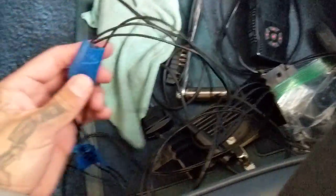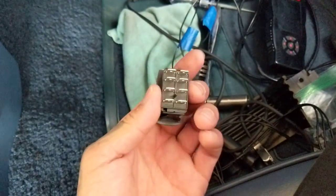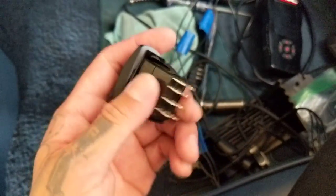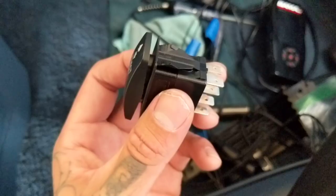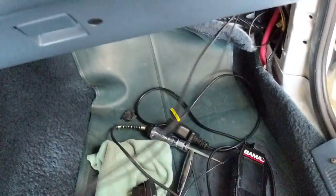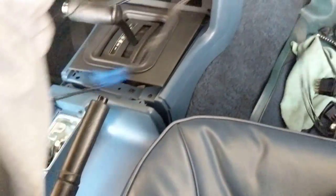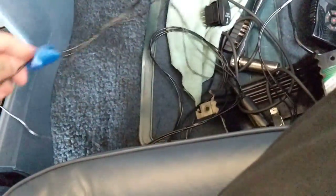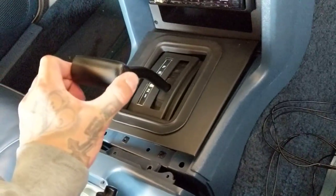It's just these three wires — don't pay four hundred dollars extra for the control pack to have that wired in. If you could wire up the car for a Coyote swap, you can do this. You just have to repin the harness — I know that sounds bad but my boy Carlo showed me how. There are two wiring diagrams I've seen: Ford Racing and Powered by the Hour, and they're both identical. I made the wires about 40 feet long but used maybe 13 feet on each — I'll run them through the center console for now and wire to the steering column later.